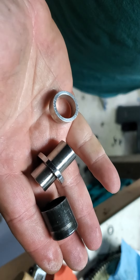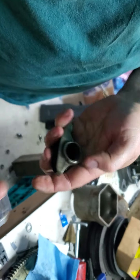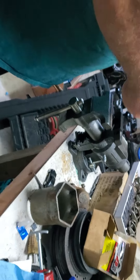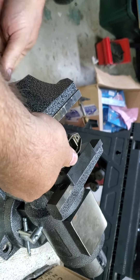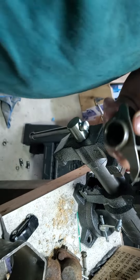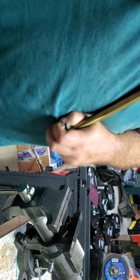Next in your kit you've got a tool — there are three parts. This part goes inside the lifter, this ring is an alignment spacer for the bearings, and then the tool itself. Stick the rocker arm right side up, come back to your bench vise, press it out the other side. Loosen up the vise, grab your tool, your spacer, the same punch, and a hammer — and there goes the bearing.